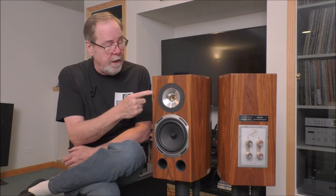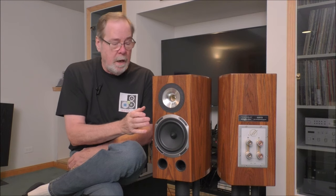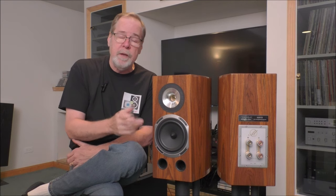So what are they? It's a Triangle speaker from France, part of their Magellan series — their top line product. This is the Duetto 40th, for 40th anniversary. It is a six-and-a-half inch two-way stand mount speaker. It uses a one-inch horn-loaded magnesium dome tweeter — I'll put pictures of the individual drivers from the manufacturer's site up here. It uses a six-and-a-half inch pulp paper coned woofer with a butyl rubber surround. It is a ported, very rigid cabinet. It's crossed over at 3,100 Hz using a 24 dB per octave crossover with very high quality crossover components: caps, air core inductors, and resistors.